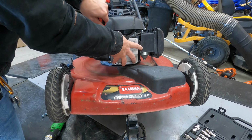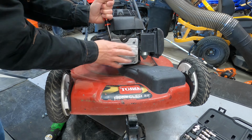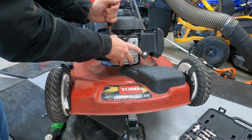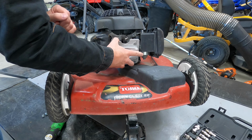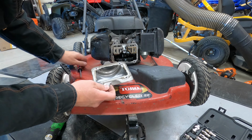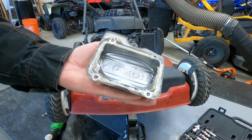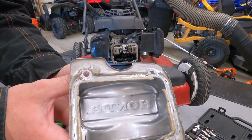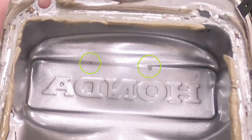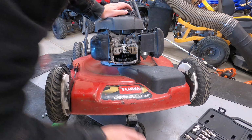These valve covers on these Hondas, at least, are typically on with a Honda Bond liquid gasket. This valve cover is garbage anyway, so I'm bending it. If you're going to reuse it, to do a valve job or something, try not to damage it. Pulling this valve cover off, you can see where the adjuster nuts were hitting the valve cover. So that kind of confirms my idea that it was holding them open.